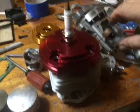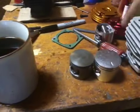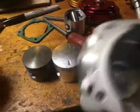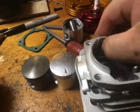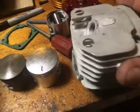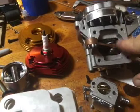for the 45. I think I'm gonna, because of the bigger bore, I arced out, I don't know if you can see it, but these are arced. I arced the transfer wall way out to the max. If I go any more, you can see this one did go through. I gotta put a little JB on that baby. But they arc right out real nice. This is for me. This isn't for anyone else. So cracking or whatever isn't an issue because it's for me. So I'm thinking this is going to be a pretty cool deal. Other than machining here to open this up so the cylinder will drop in,